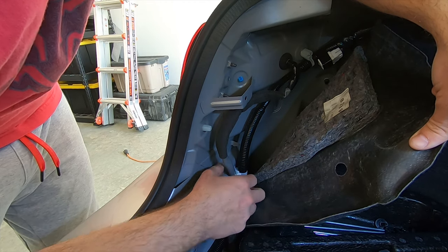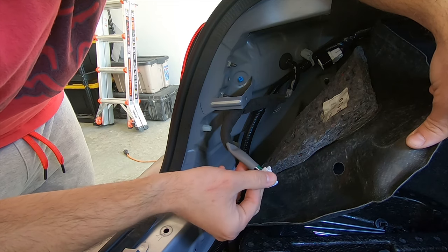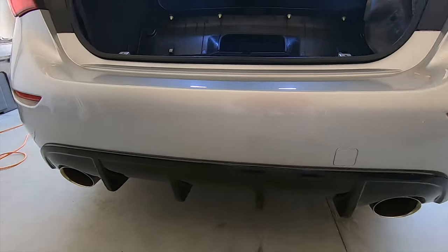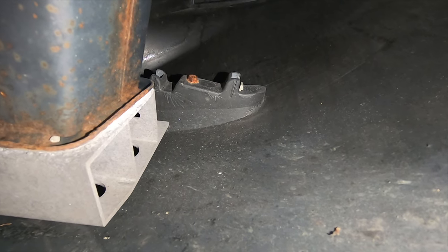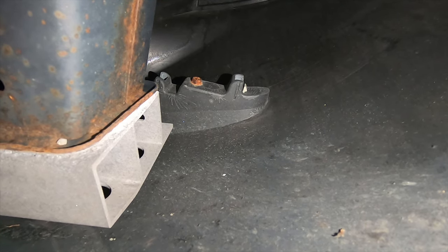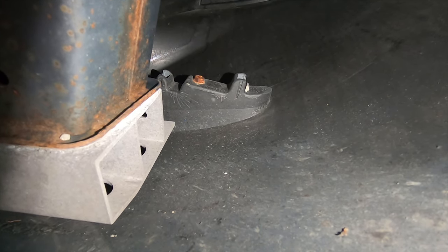This is the clip that is going to be used to piggyback the signal off the back side to get the rear sequential light to work. I'm going to go ahead and unplug these so I'll be able to test the circuits. The reflectors themselves can actually be accessed from under the car — lay down and look up. In the center of the reflector housing you'll find a 10 millimeter screw that needs to be removed. Once that screw is out, press the little white clips on the left and right side inward toward each other, then press outward and the reflector comes right out.